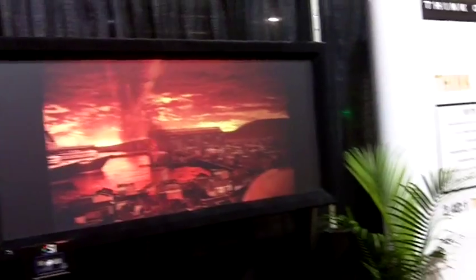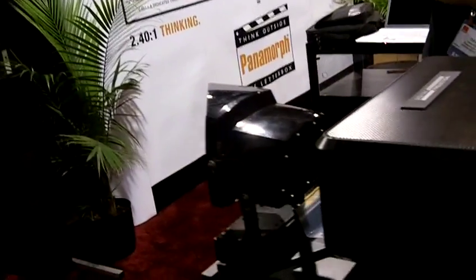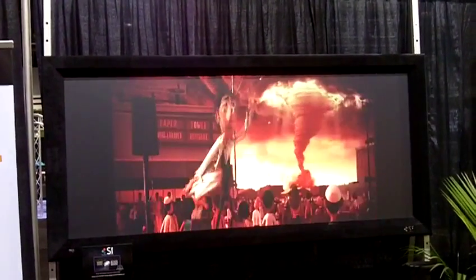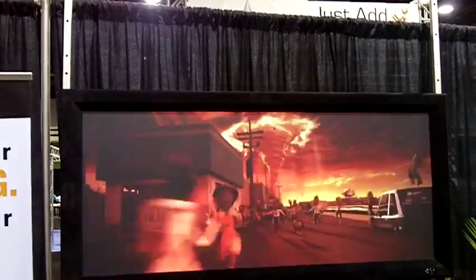The scaler will electronically enhance your image, stretching it vertically to eliminate the letterbox bars. You're now using all 1080p vertical lines of resolution to create picture information. But now everything is stretched and distorted vertically. Our lens moves in place to correct the image geometry back out to 2.35:1 original cinematic aspect ratio.